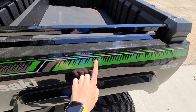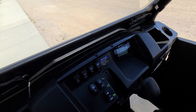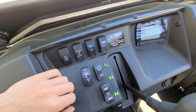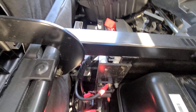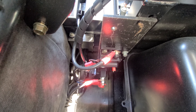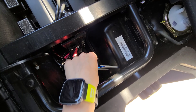Here's the switch for turn signals. The winch is right here and there's a strobe light that'll get put on here eventually. Underneath we hid the contactor for the winch and the circuit breaker - it's all down in there. Battery's right there. Our next thing to do is get a fire extinguisher and tuck it in here.